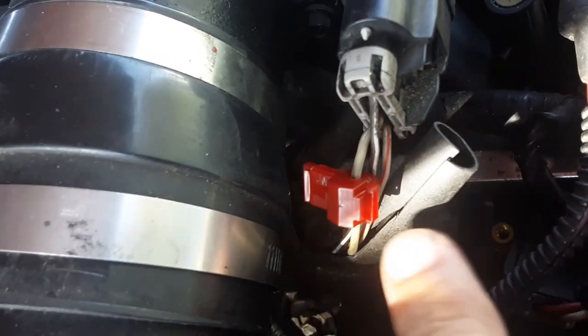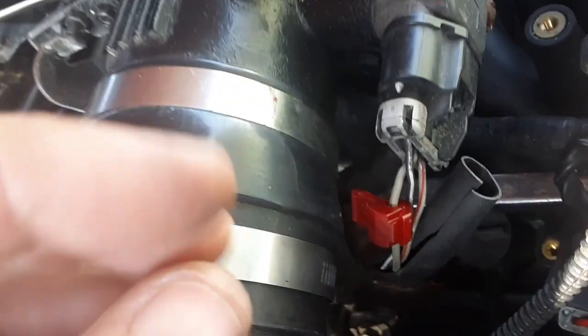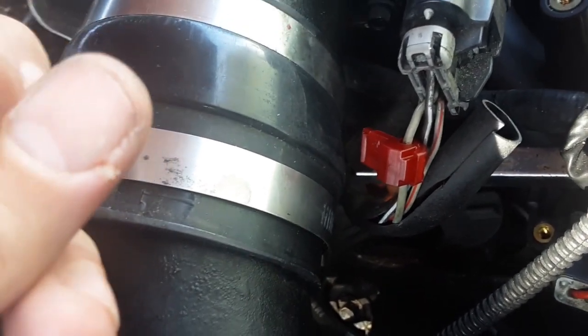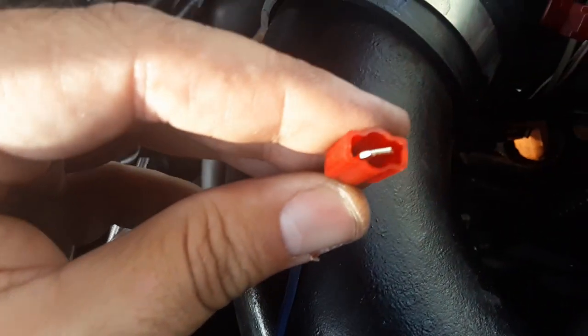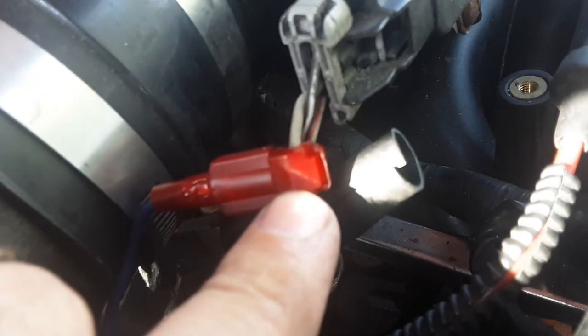And you notice when you close it, it has like an opening on this side. You can strip out some of the wire, but it's designed to close. Even if you don't strip out the wire, it still cuts through the sheath and touches the wire. But I strip back some wire and then put it on. That opening is for a spade connector, so that'll slide right in. So there we go, spade connector tied into that, everything's tapped together.